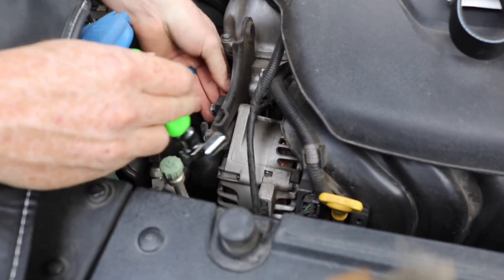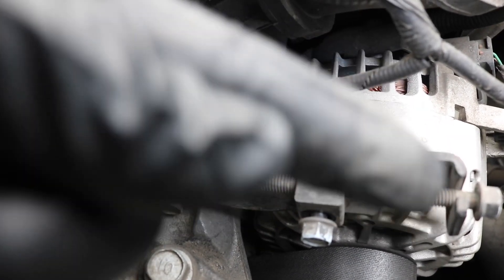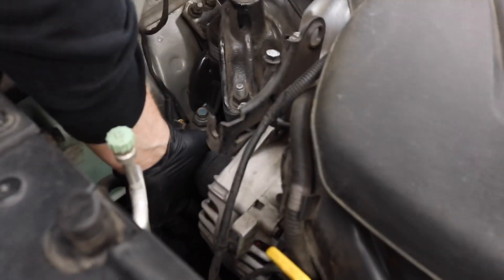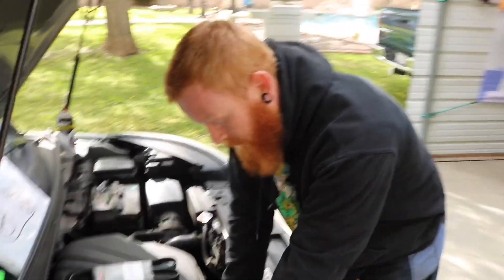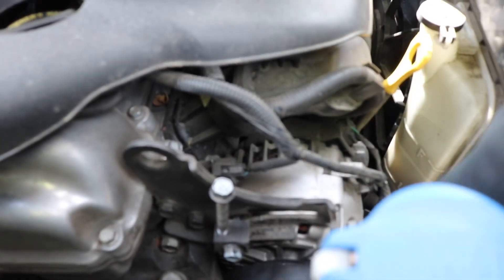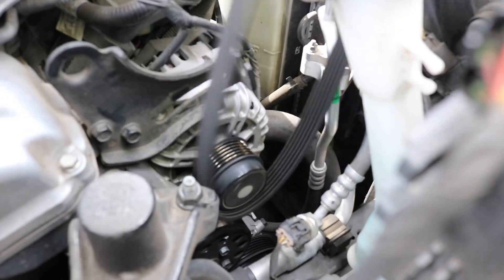You can already see how much it's already pretty loose. That's the bolt we loosened up right there, and then loosened up that one. There's a 14 that's kind of like right below the pulley — just loosen that a couple times and see if that helps shifting that alternator back and forth. After you loosen that, you can literally see it's shifting — push it back so it stops and that gives you the clearance to take the belt off. Pull your way out and just like that, belt's out.